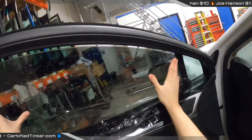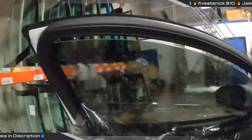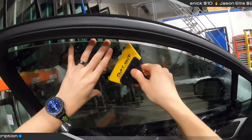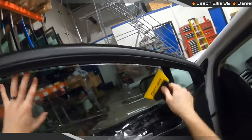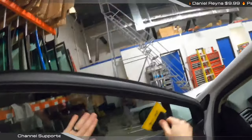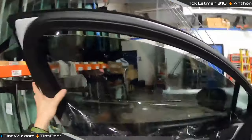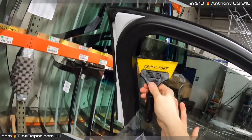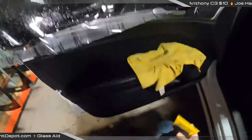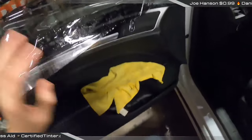So just line up your top edge, and that's gonna be the main reason why you're getting stuff, because I can almost guarantee that you're fighting with your front or back edges while you're trying to install the pattern. That just comes with experience and technique. Those are the things to watch out for and practice over and over. But if you can do that smooth and well, your windows will come out much, much, much cleaner.